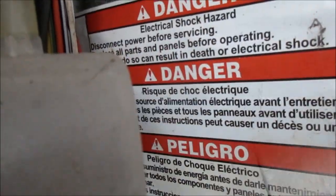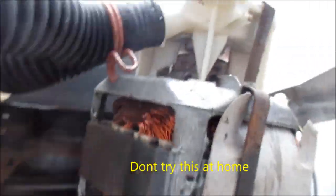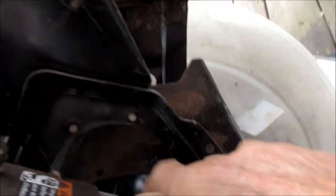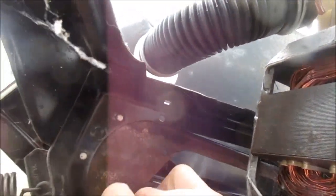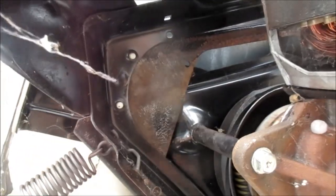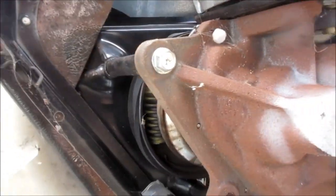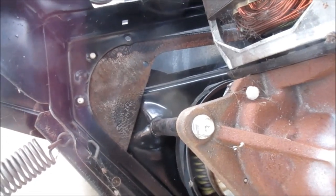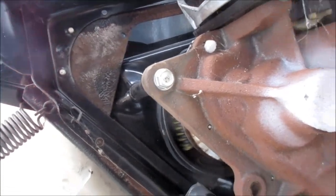To access the shoes on this side, we basically have to lay the machine down — there's probably another way to do it but that's what I do. You can see these two little things here — there's a little shoe on top and this plate looks rusty, rubbing straight against the pyramid platform. The plate is supposed to ride on top of those shoes and when they're worn down the machine won't balance easily.